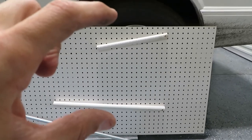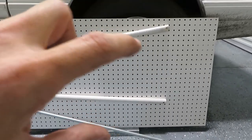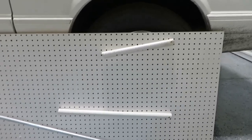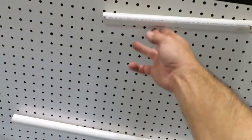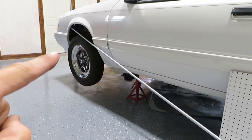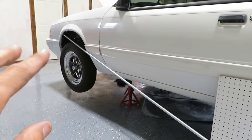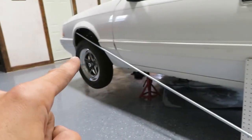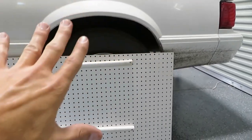Lowering the car gives you that angled control arm, so when the housing rotates and tries to straighten it out, it presses down. To get the car to squat, you'd keep it at normal ride height — the upper arm being higher up puts your instant center way out front, so you get no separation at the rear end and the car squats. That's how that works — there are a lot of ways you can play with it.